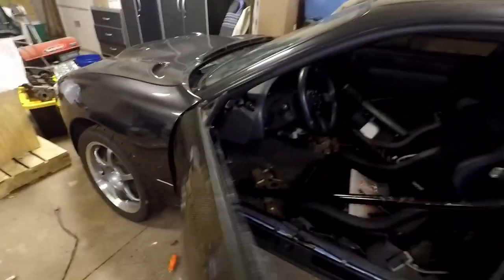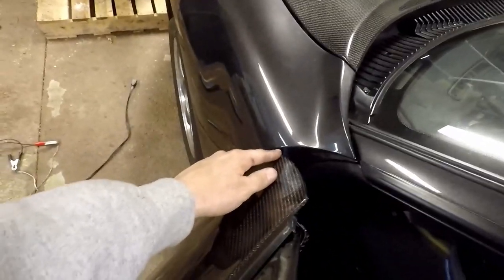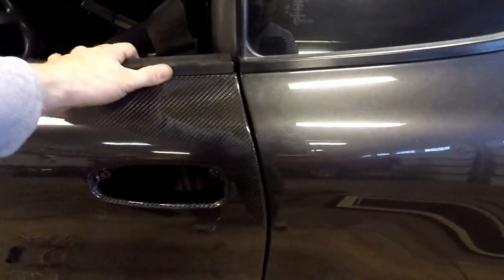Alright, the door's on. On the passenger side it was off just a touch and I had to put washers in between to space it out because it would touch the fender. But on the driver's side, I had to put washers between the body just to give it that little one-washer spacing because otherwise it was too tight. The driver's side body lines look great though.